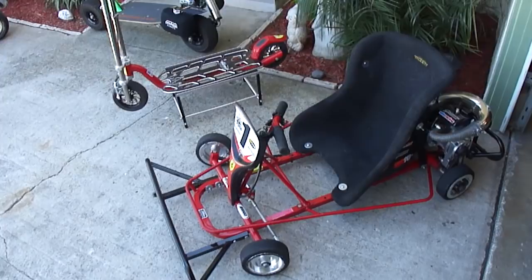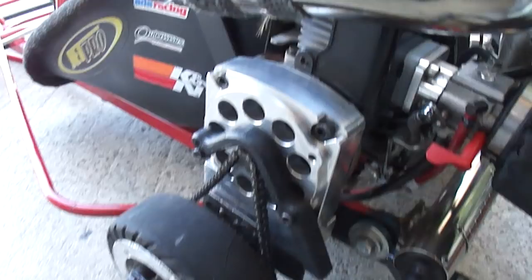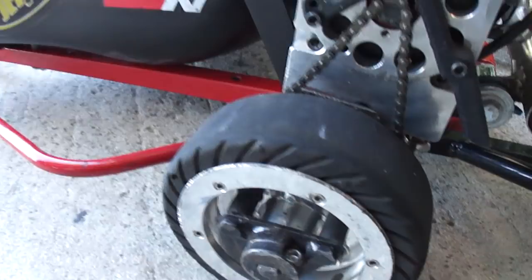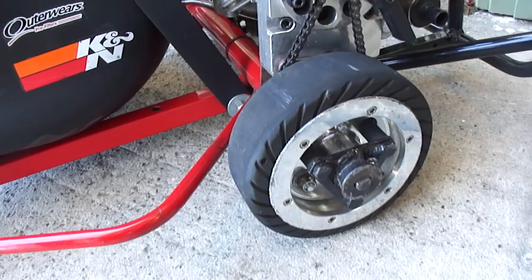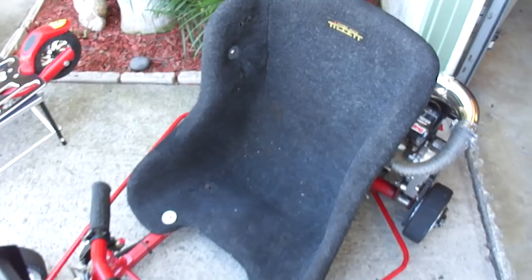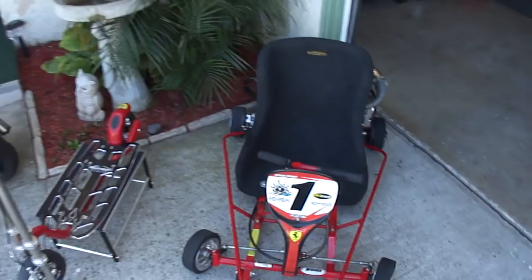Next up I've got my Ferrari go quad — it's a Supergo quad 46 live axle. Got a Jet Pro quad pipe, Grip Tech motor mount, and a couple of little custom goodies: front and rear bumpers, because when you're racing these things you're tending to bump into people quite a bit — good to have bumpers on there. Running a custom B-lock rim, modified so you can run it with a live axle setup. I did that because when you're drifting around turns, you don't want those tires coming off — the B-locks go up about a quarter to half inch on the tire, helping keep the tire locked in place. Got a tiller race seat, my custom number plate, all my cool Ferrari logos, goat head, and all that kind of cool stuff.